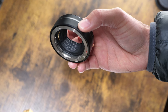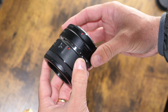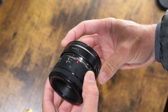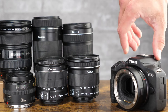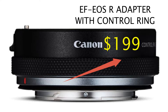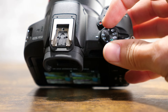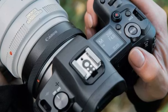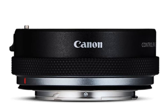Let's talk about build quality. It's got a metal mount on both sides, and it really feels like just half of a 50mm STM lens, both weight and size wise. It's quite lightweight at under four ounces, barely adding any weight to the front of the camera. There are actually four total different adapters available. The basic version for $129, and then the adapter with the control ring at $199 — that's $70 more. The control ring allows quick access to adjust exposure settings such as ISO, aperture, and exposure compensation, which could be handy, particularly with a large telephoto lens.